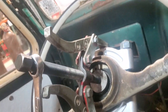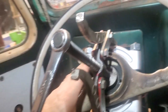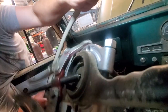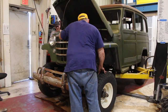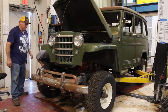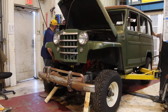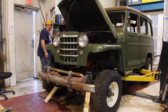Here's the setup — just a regular two-arm puller with the bearing puller behind it. We start cranking on it and there it came — it works! Now that the steering wheel is off, we can raise the body up so the steering column shaft can go through the bottom of the floor. We actually have to roll the frame forward a little bit while lifting it up, going back and forth — rolling the frame forward and lifting the body simultaneously so it can clear the steering column hole in the floor. We ended up getting it off pretty easy after that and then rolled the chassis out from under it.